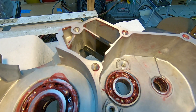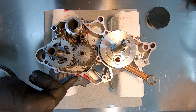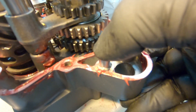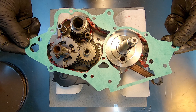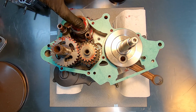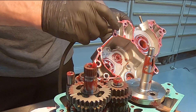There's a little baffle here - don't forget it. Moving to the dowel pin side, you need anti-seize made specifically for aluminum and metal bonds - you don't want those dowel pins permanently affixed inside the cases. You can lube the case faces too; if you ever have to disassemble, it's nice to have lube on those cases. You can rub the gasket or put lube on the material surface either way. Set the dowel pins, then drop the gasket from Wrench Rabbit down and align it over those dowel pins. Also lube the shift drum and pins, and don't forget the breather before you start putting the case halves together.